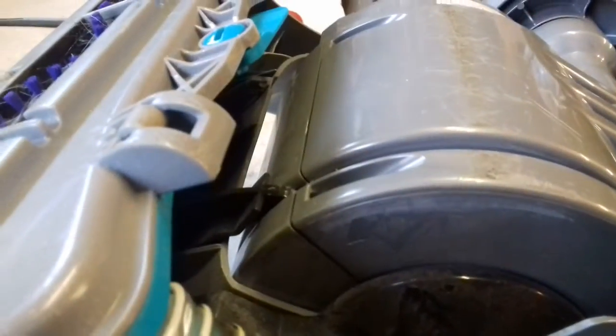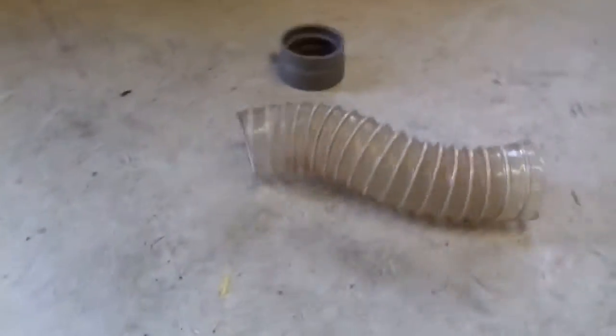It's going up properly. So I'll reassemble it and we can try cleaning the filth pile over there that I made with the Alyx. We're reassembled now. As you can see, that internal hose is pretty done, but after a good wash it'll be fine. So is that filter, just needs a wash. Hopefully it'll come up well. But we have a good internal hose in it now, and as you can see, that spring is what it should be like. But then again, when they're very, very springy, they can sometimes strain the belts a bit, so you have to have nice tight belts as well.